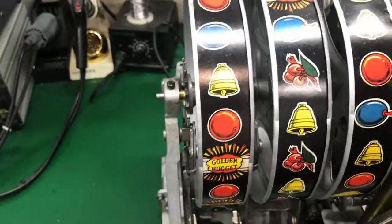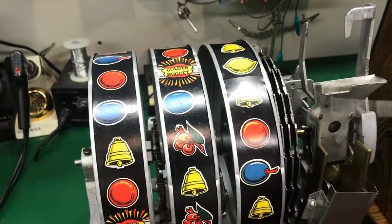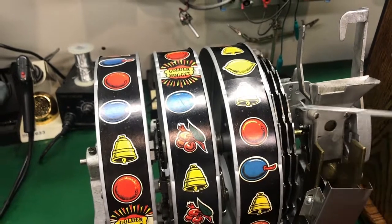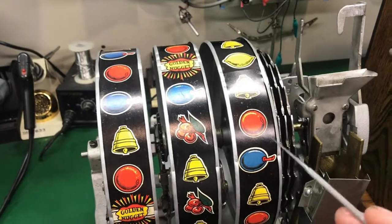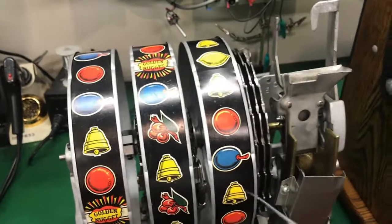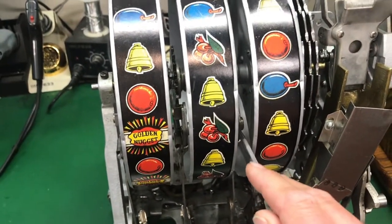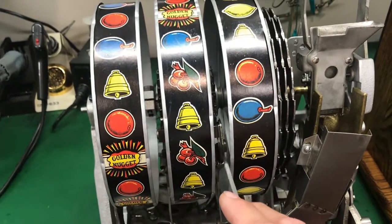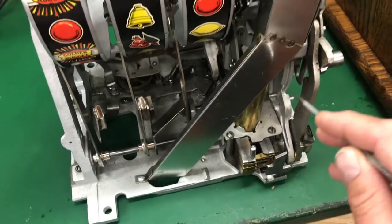The score reel assembly — this reel is attached to this plate, kind of a sandwich: middle reel, middle plate, outside reel, outside plate. This whole assembly is calibrated and stays together. I pulled it out, made sure all the stops and parts moved, and put grease on all the high contact points with a good oil.